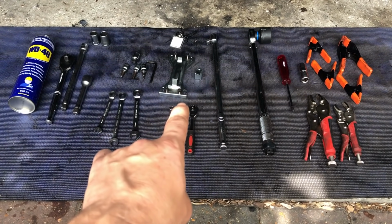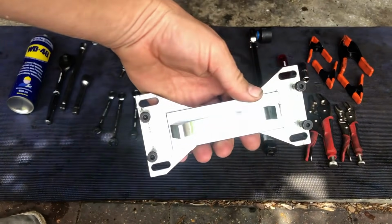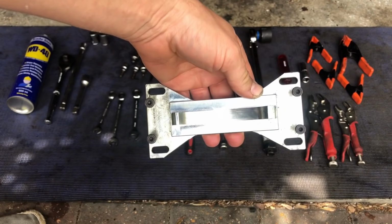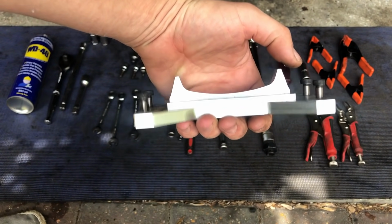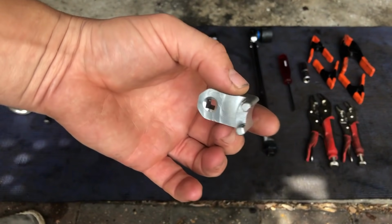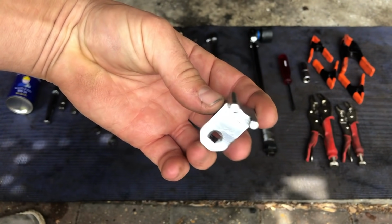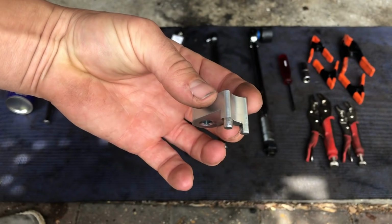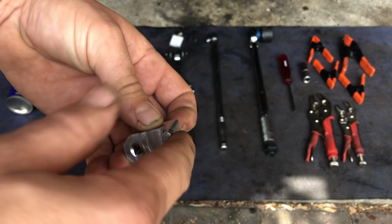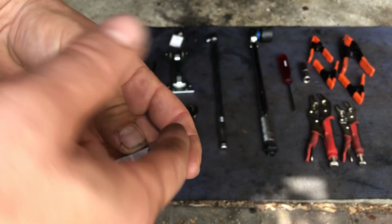The specific key tools for this are these two, and I'll show you those. So this is our locking device for the crankshaft. Again, at the end of the video, I'll show you how you could possibly make one of those yourself, free of charge. This is our cam tensioner bearing little device, our tool for tightening that up. I think a VW one might work with this, but you might need to just grind out the cutout there so you can get your 13mm socket on if you get a VW one.